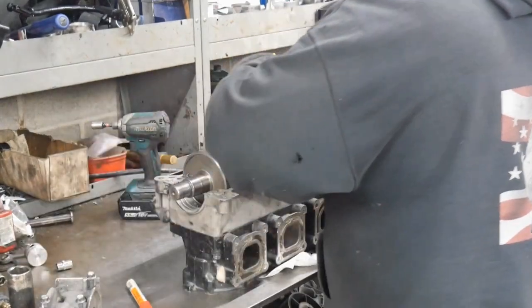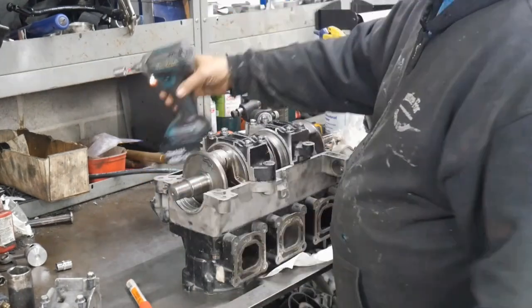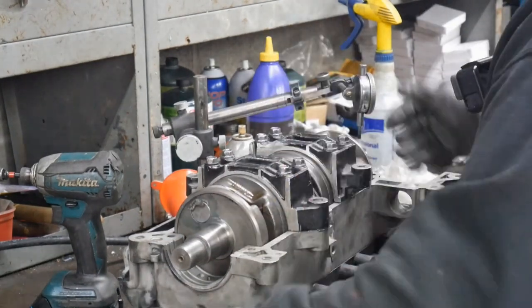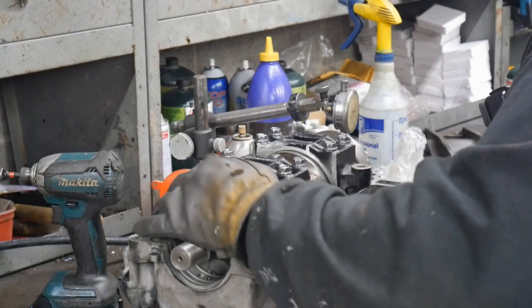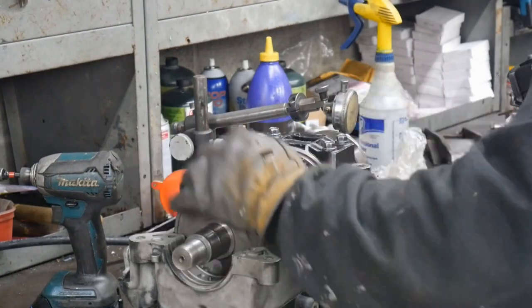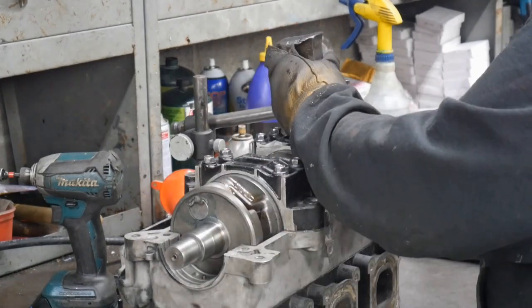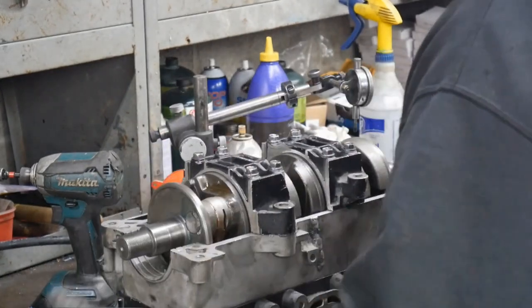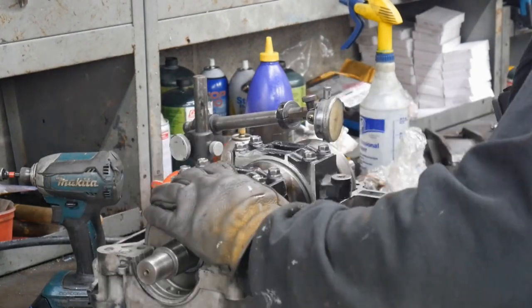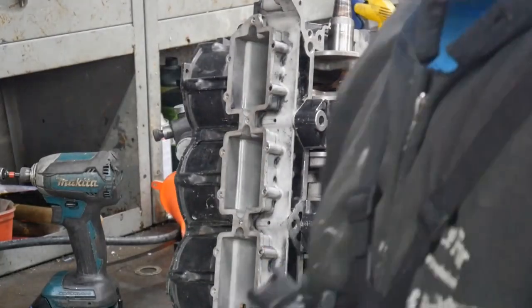Very rarely, you'll have to go in and use the angles in between those positions, like between 3 and 6, whatever. But that is super rare. Most of the time, you can get it no problem just by using those two positions. And then you also got to think about when you're hitting the 12 and the 6, if the 6 is low instead of high, you can try hitting the crankshaft from the end to force it up, but a lot of times you have to put it in the vise and use the vise to squish it. Bring it back and put it back in the cases.